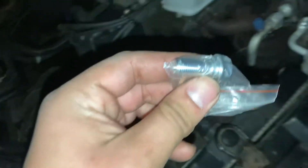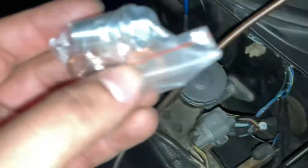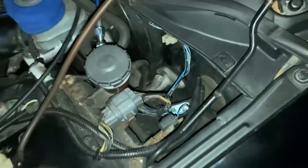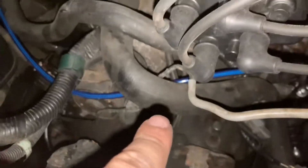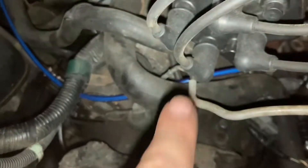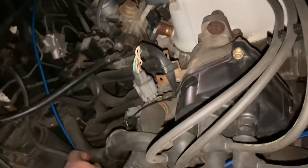We're back. I still haven't put these on yet, but the homies Joe and Dennis were telling me how to put this on. It's washer, fitting, fitting, washer, banjo bolt through there. I'm gonna try to do that. They told me not to have the line snake around — it is on a cooling hose — so I'm just gonna snake it out and try to fix it up and do it right.